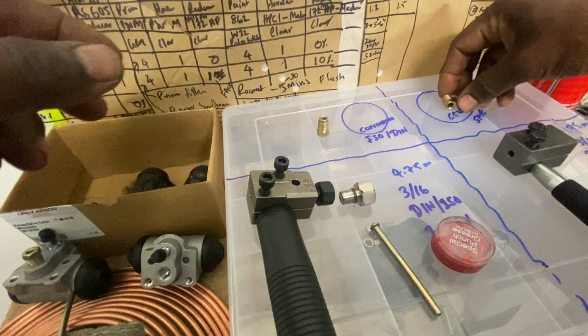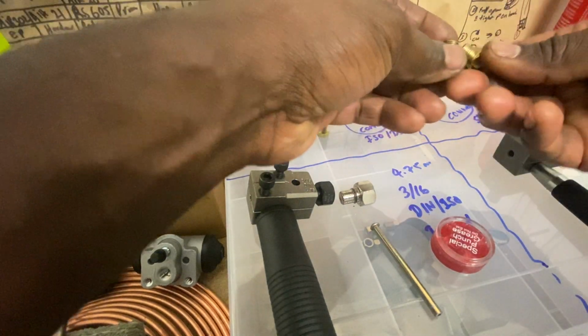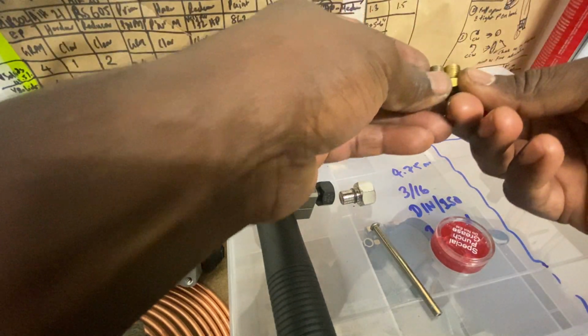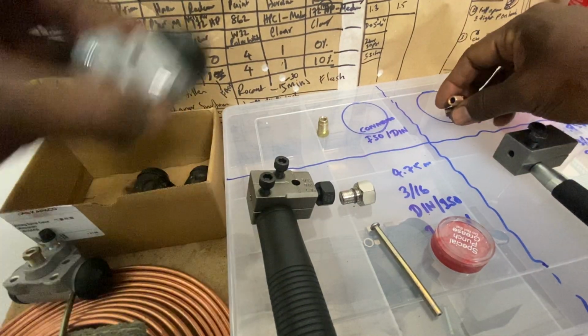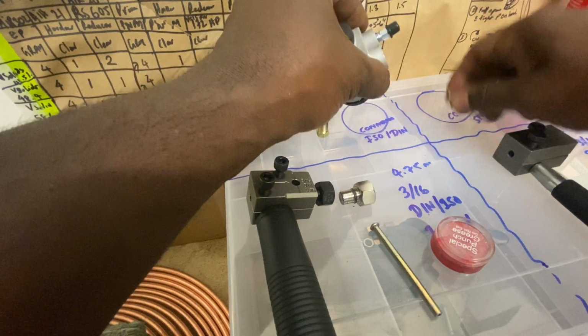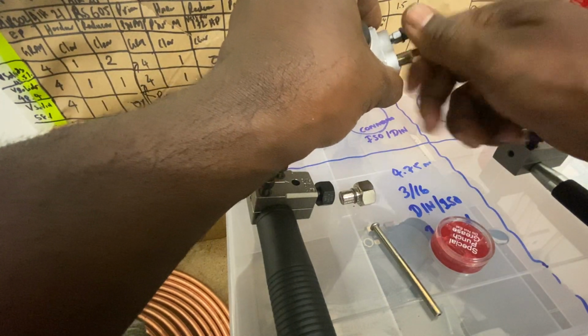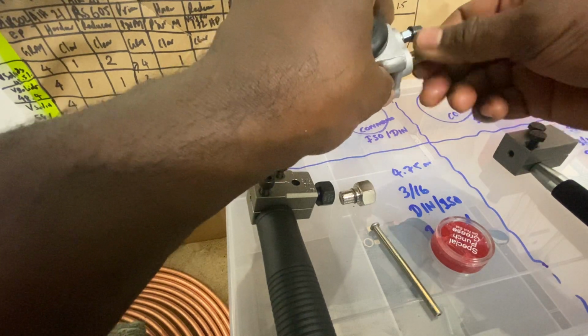Whereas the DIN and ISO, the SAE ones go straight all the way, thread to the top, as you can see. And these ones are not interchangeable. So when you put these ones, let's get the longish one, put this one in there. See, it's got a fair bit of play.